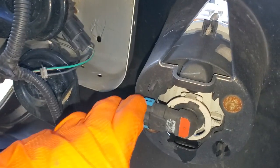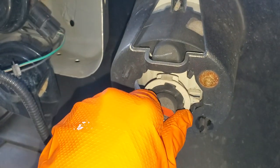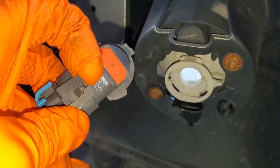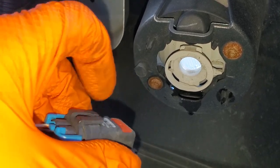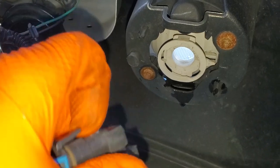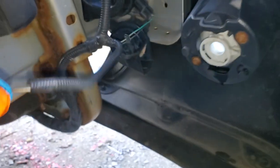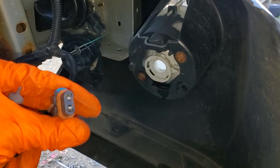So here it is with the correct bulb installed. To remove it, you rotate it counterclockwise and then pull it out. To disconnect it, you just peel up on these two tabs while you separate it out. And before you install the new bulb, you're going to want to look inside the connector and make sure that there's no corrosion present. If there is corrosion present, you'll want to replace the connector as that can cause issues.